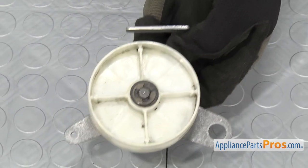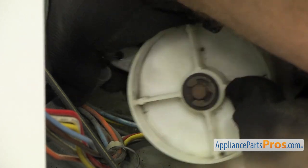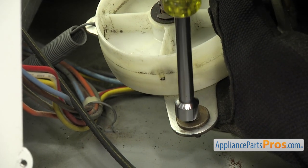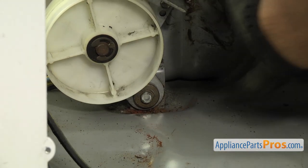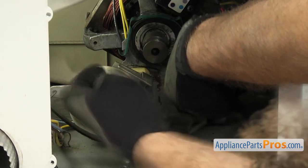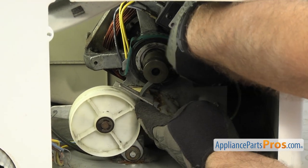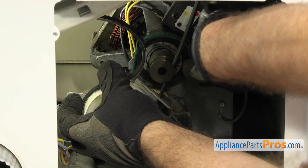Now that you have the assembly put back together, we can put it back in the dryer. To put the assembly in, the first thing we're going to do is reach in and hook the spring on. Then we can put the spacer with the screw in. We're going to use the 5/16 inch nut driver to guide this over and line it up with the hole. Once you have the screw tightened down, you want to make sure that the shoulder washer isn't jammed up and that it moves freely. Then we can put the belt back on — we're just going to put the belt in between the finger and the pulley and wrap it around the pulley. Then you want to make sure that the belt goes on the opposite side of the motor pulley, and we're going to grab the idler arm assembly and pull it over and loop the belt over the motor pulley.